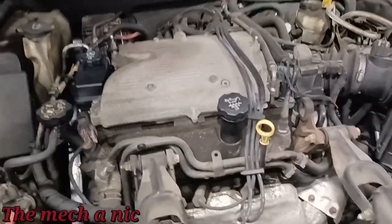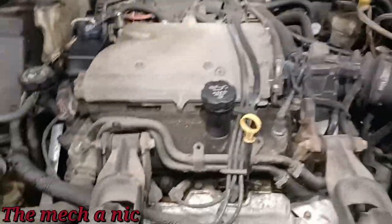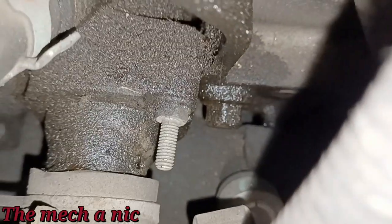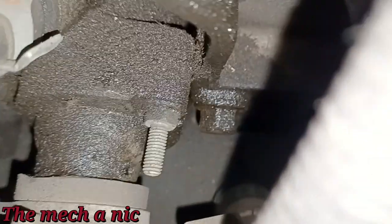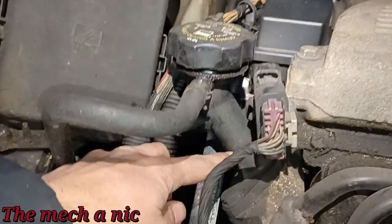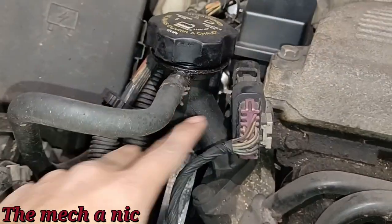It's like the more I look at this car, all the memories are starting to flood back to me. We were talking about a slight coolant loss. It could be losing coolant. And guys, here goes the thermostat housing right there, and you can see how it's wet around it. So that might be our slight coolant leak. As you can see, it wasn't a lot, because the coolant's probably sitting like right here when it should be all the way up top.